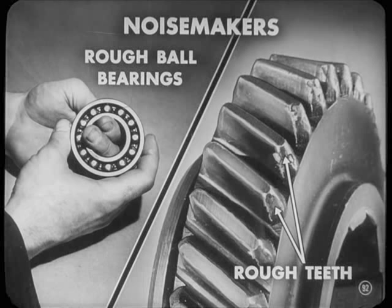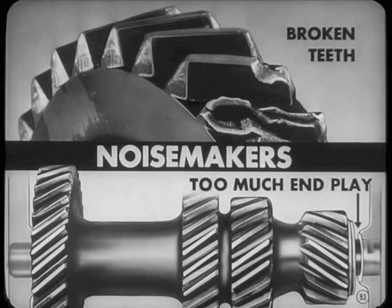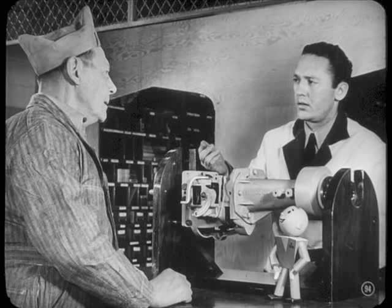Well, if you hear a steady clicking, you probably got rough bearings on the pinion or main shaft. If it's a whine that seems to get higher when you pick up speed, you'll usually find the teeth are rough. If there are any broken teeth, you'll hear a fast bumping sound. And if there's a clunk when you give her the gas, maybe the thrust washers are allowing too much end play in the cluster gear. What the dickens can cause all those troubles?